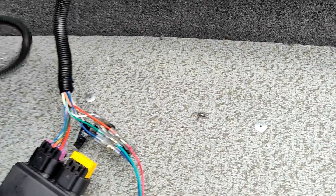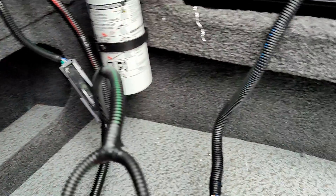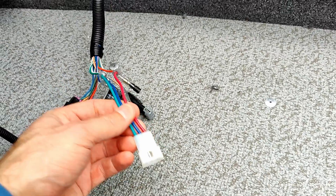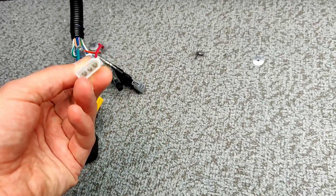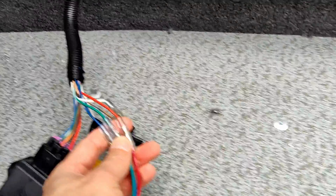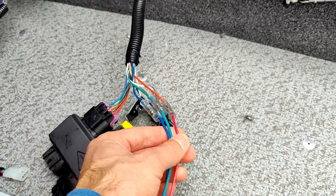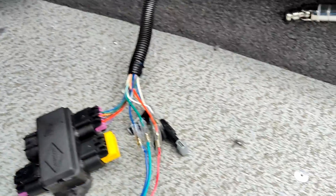One thing I had a hard time with is there's supposed to be an adapter — this is for your trim switch — and it goes on this side of the wiring harness that comes off the CMU. You need to plug it into this plug. I could have cut it and soldered it, but I want to be able to remove it. I looked up the Lund trim adapter — it comes with a splitter that has the right type of plug to connect into the wiring harness that comes with the active trim unit. I did end up soldering these — I was going to use bullet connectors, but soldering was easier, and it's my boat and I plan to keep it.